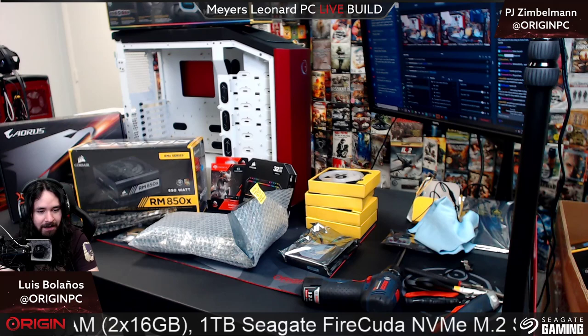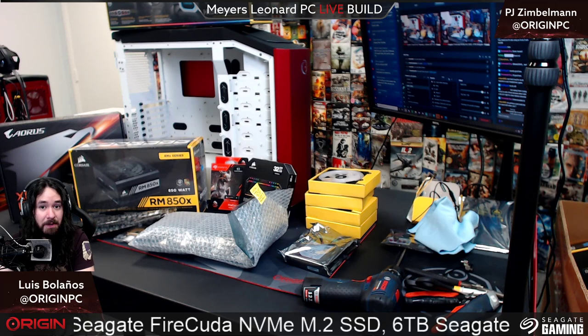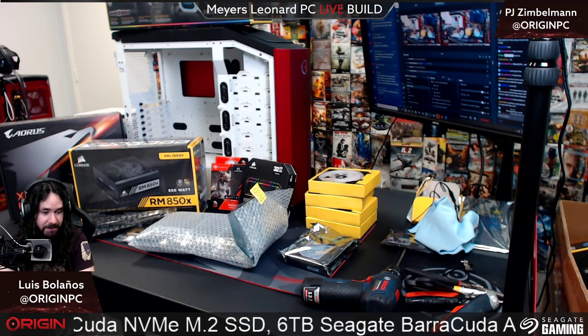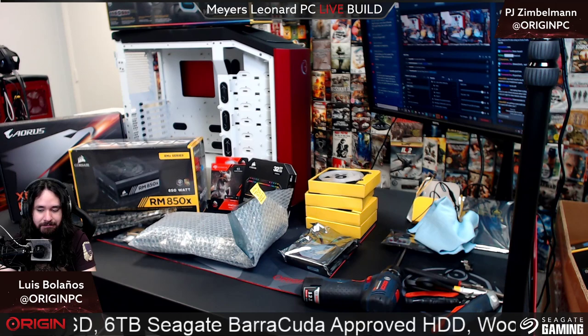I'm building my first system this weekend. I'm a little nervous. Any advice? Number one, don't be nervous. You need to read up on everything you possibly can about your parts and whatever you got together. Make sure you're familiar with your components and your case, especially your case, because sometimes cases have little nooks and crannies that are really good for the cabling. Make sure the little things for the motherboard are set there. And if you haven't watched a bunch of guides, please do. The problem with guides sometimes is they show you how to build a PC for a specific case, so it might not apply to you, but the overall mechanics and general ideas are still there.